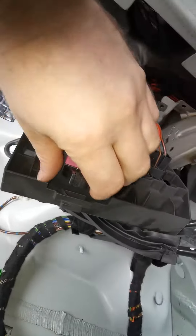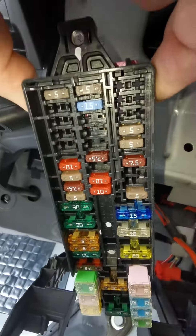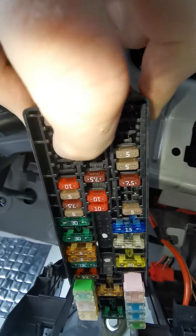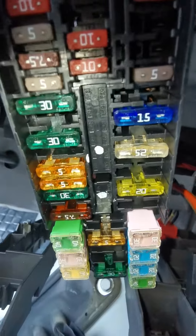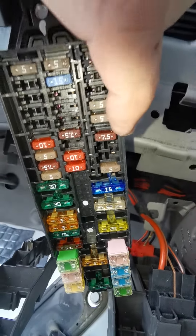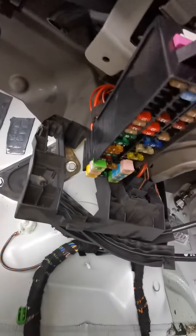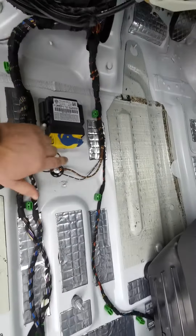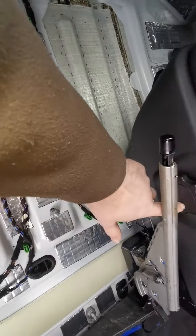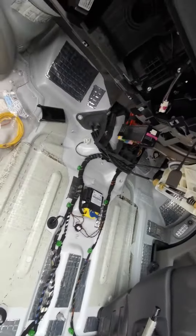To get it to work you're going to add your own fuse into the front here — either there, there, or there; even the bottom ones are spare as well — whichever circuit you want. I'm doing it on an additional USB in the back, so I'm going to be adding one of these, running the cable across here, round and up to the back of the cab. Okay guys, thanks for watching.